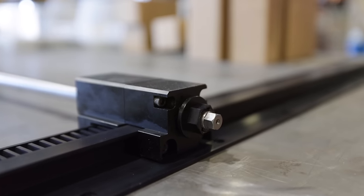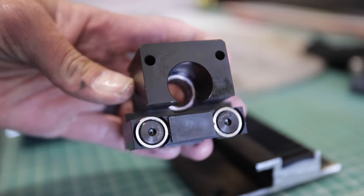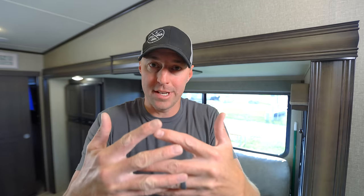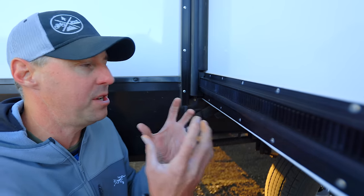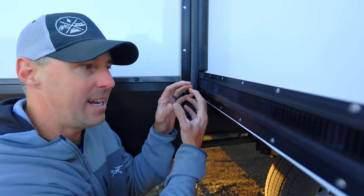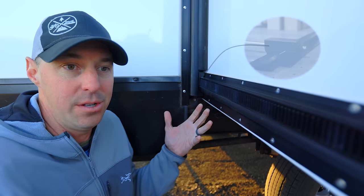One of the biggest things that make the system more reliable is the way the gears mesh together. It's the pinion gear housing mounted to the side of the slide-out that makes for perfect gear alignment, counteracting twisting and allowing movement. It has two cam followers that keep the gears in mesh — fitting together well all the time. That's what eliminates the metal shavings and wearing down of the slide parts. This element can't be overstated because it has so much impact on how the system operates.